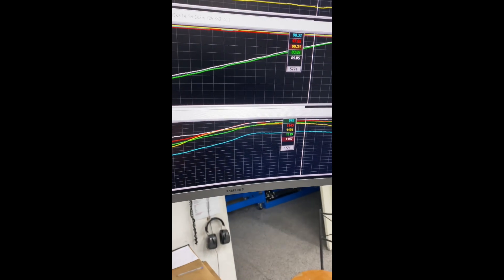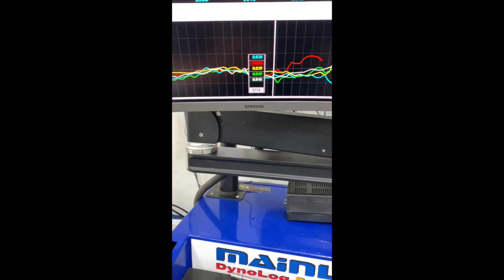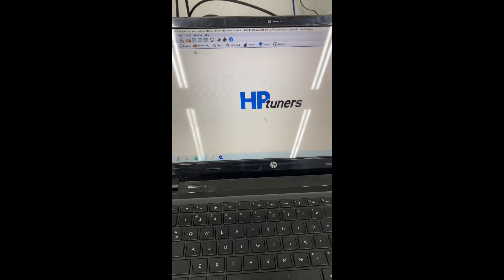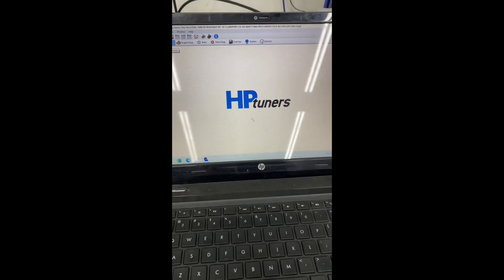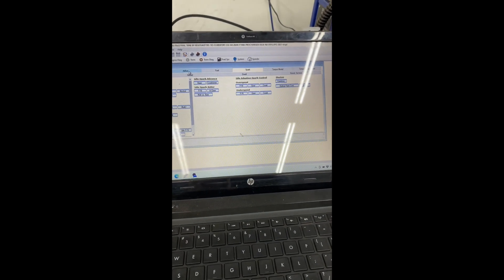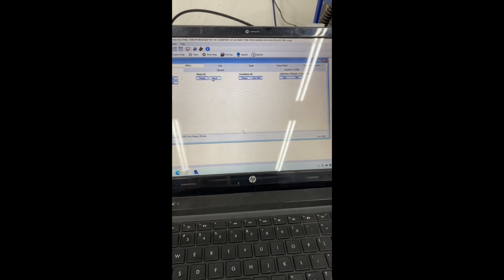Our lambda readings — this particular car is an E40, so what we use is HP Tuners, and we also use a lot of EFI Live. On this particular car we had to do some slightly unusual tables. We have our boost tables and some of our numbers — the MAP sensor in it does run out on this car at 207, so the resolution is not perfect, but we've got to do what we need in this particular application.